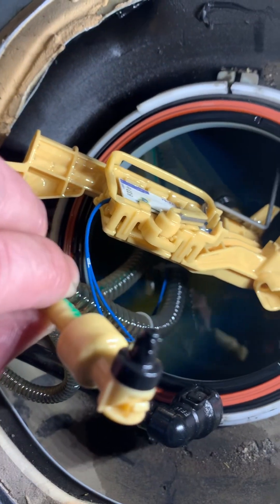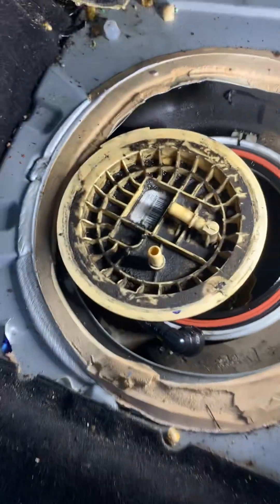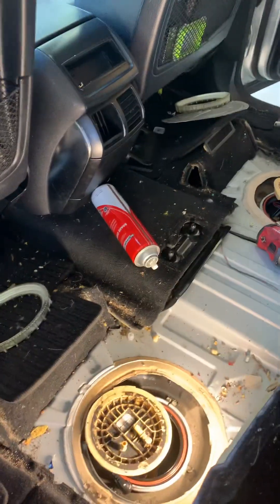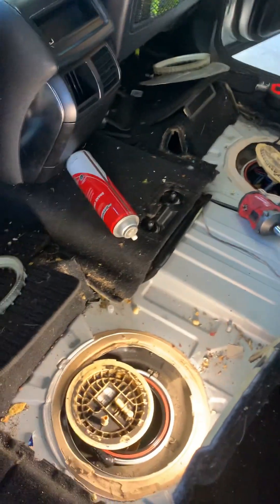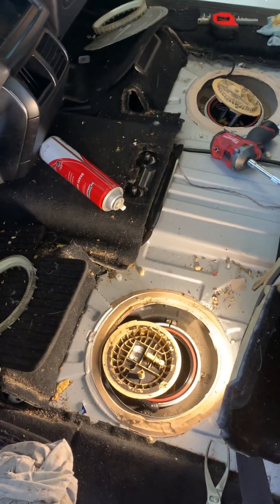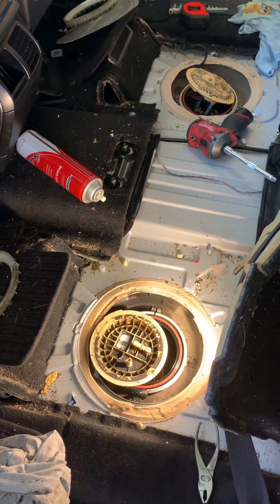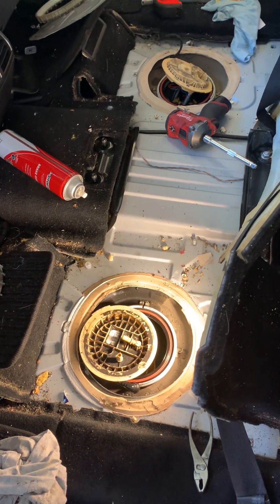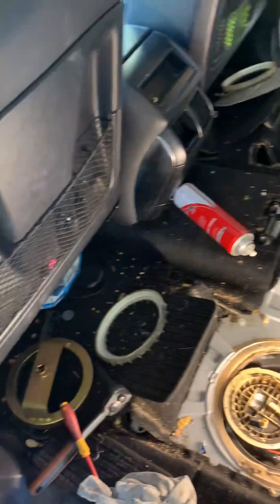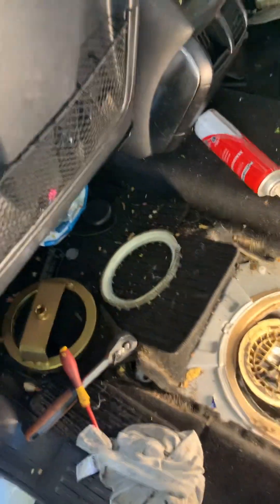Because it's basically a little jet that's pushing fuel. I figured out after a lot of stuffing around that it's more than likely just a blocked fuel filter — we're not getting enough flow, supply and return, to the tank for that venturi effect to work. So it was a couple of hours of stuffing around to get all this stuff out.